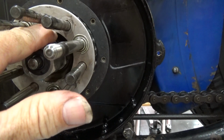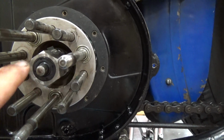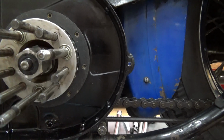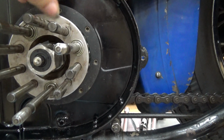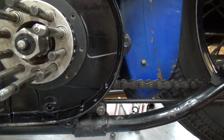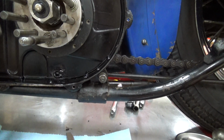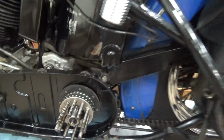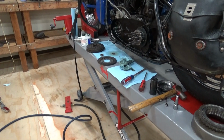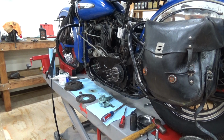Now there's no excuse for bending the shit out of this, as you just saw. Use the right tool, right? You only need one. Make sure one is done. When you start bending this, this here is what holds all that grease in. So if you bend it, it's going to arc, allowing your grease to escape. Don't do that. That's what these are for. This is pressure plates to keep this flat. Don't bend the shit out of this. You'd be amazed how many people do that. Like almost everybody. Okay. As you saw, there's no excuse for it.